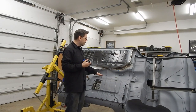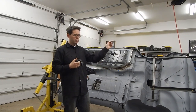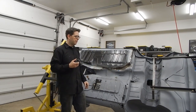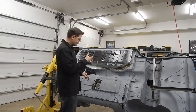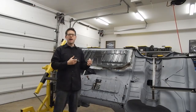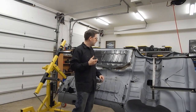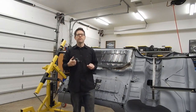We'll go ahead and grind those down - it'll be nice and smooth. We've done it here already so I'll show you - these are ground down and we've got a little bit more cleanup to do, but this is stitched here and you can't even tell where it was stitched - it's looking really, really good. You can see I did coat it with a little bit of weld-through primer, which is why you have these burn marks. I prefer to really just use it where you have sandwich pieces so I have some sort of coating in between them. I had done it because I left this for about a week and I didn't want any flash rust. That weld-through primer is very zinc heavy and you run the risk of zinc fumes. We've also got a little repair panel here where again we had just too much of a gap - about a half inch at one point. So we cut a little extra away to give ourselves a nice repair panel, did a lot of hammer and dolly work to get everything to line up, and once we had everything tacked in it was a matter of just going in and completing the stitch all the way around.